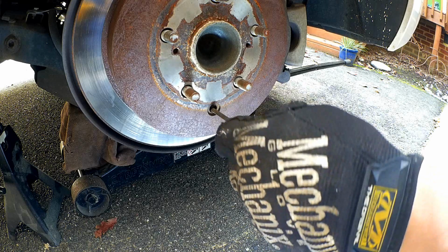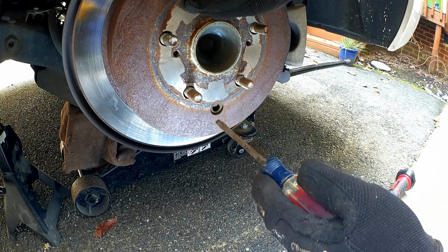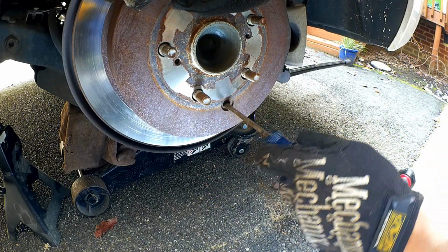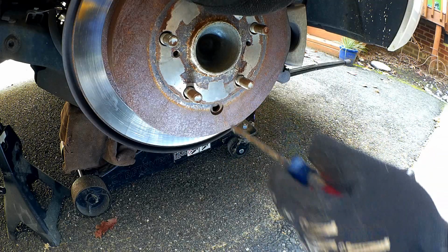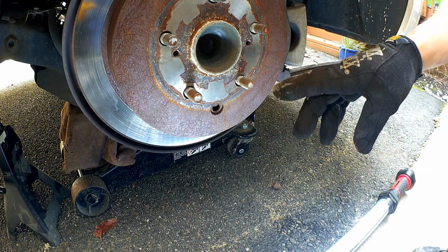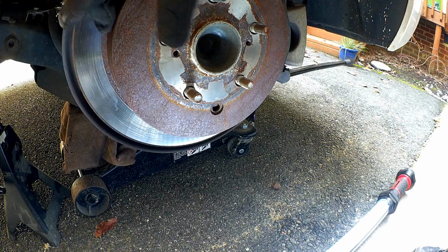Now that you have access to it, you should be able to see, but you can't. They put this drum on incorrectly, and so I can't actually get to the little gear. Man, well, we can fix it. There's one way to put the drum on. Obviously, it's got a 5-bolt pattern, you can kind of spin it however you want, but unfortunately, if you don't put it on correctly, you can't access the little gear that spreads the brake shoes to expand out onto the drum itself.